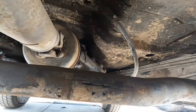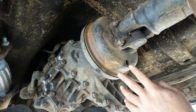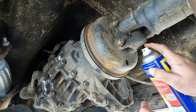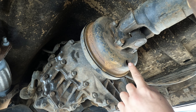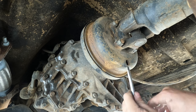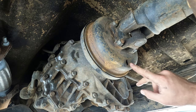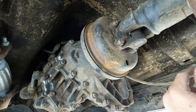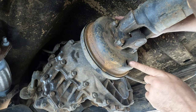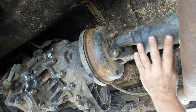Get yourself under the patrol and there's your handbrake assembly. Sometimes these rubber grommets will be missing, but if they're there just give them a good coat with WD-40 before you try and pop them out. Get the screwdriver underneath and just work them. They will be hard to get out sometimes and possibly break, so be aware you might have to buy a couple of spares. There's one at the bottom and one at the top, but don't worry about that for now — we're just going to move on to removing the drive shaft.